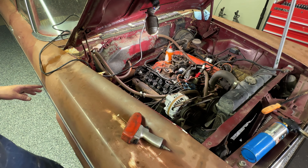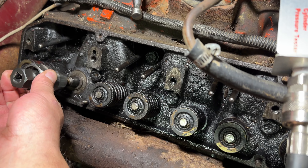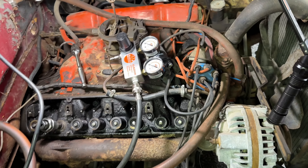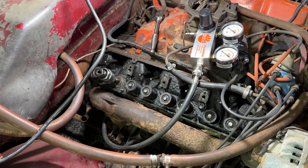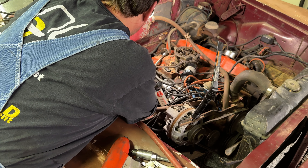I already checked the other side — the other side is good. Maybe with any luck we can fire this hog up. Current situation: we have the valve loose, which is great. The valve guide is probably smoked, but it doesn't matter — it was junk when we started. So what we got to do is hold the valve up while we take this off, because it's going to fall on the engine. What we've got to do that is a leak down tester screwed into the spark plug hole. We're going to charge it with air and then air pressure should hold the valve up. I can hear a lot of leakage going into the crankcase and I can smell it real bad too — probably got some stuck rings or scored pistons on this cylinder.